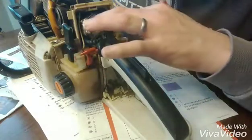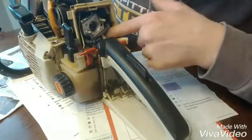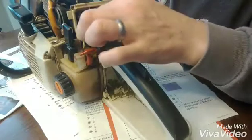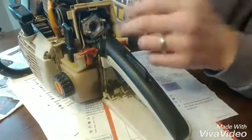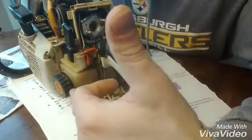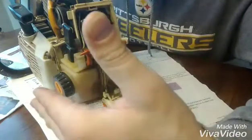When you put it back on, you'll put the linkage back on, connect the impulse line, and then slide the carburetor back on, put the two nuts on, and then just do everything in reverse order. The last step you'll have to do then is grab the fuel line down on the inside and attach your new fuel filter. Then you're good to go.